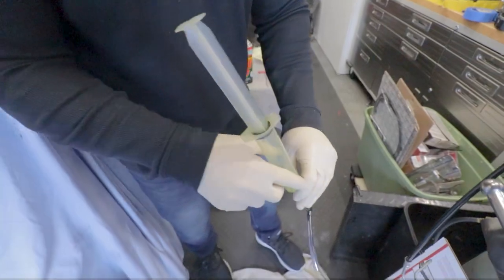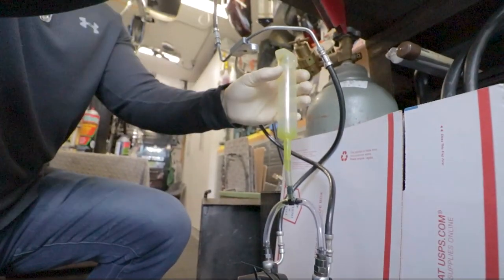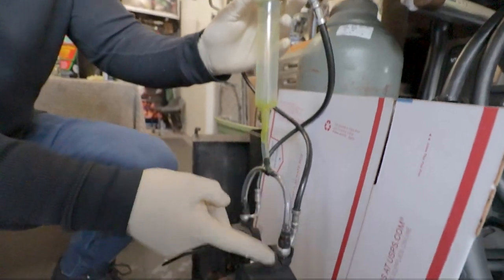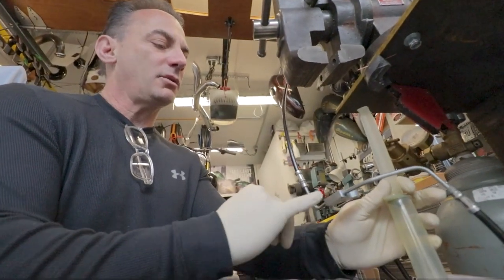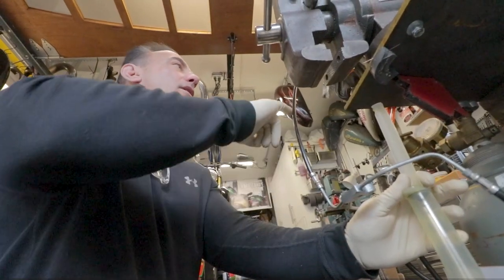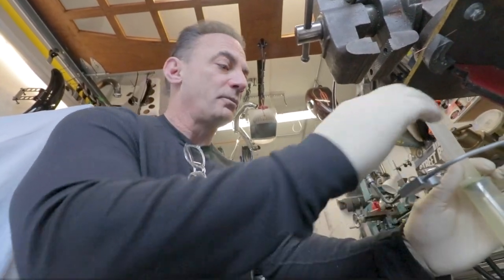This sits on these two nipples right here. Johnny's going to fill that with brake fluid, crack open the bleeders, and push down. It'll shoot fluid into both sides evenly, coming up through these brake lines and pushing all the air out. When it gets to the junction block it goes to one line. All the air bubbles should go out through there. It may look like a Willy Wonka contraption, but it's super simple — and we'll be able to feel if we have brakes by squeezing the master cylinder on the disc clamped in the vise.